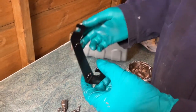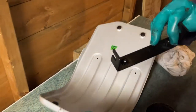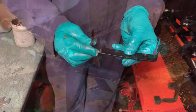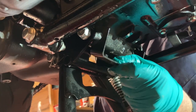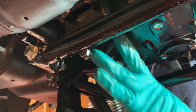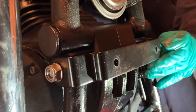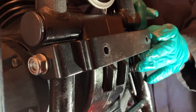This is the bracket that goes underneath, so it will be attached like so. I've already loosened the bolt off underneath — because it's got slots in there, you just get into the bolt like that. So we're going to put this under there; it should go in between the head of the nut and the bolt, just slides in like that. Then we're going to pinch these bolts up, get it in a nice square position — fairly tight, just giving a little bit of movement so I can get it in the right place. When it's in the right place for the bash plate, I'll tighten them up good and proper.